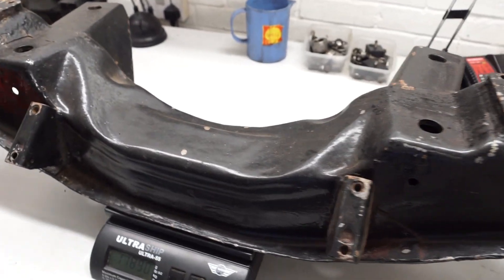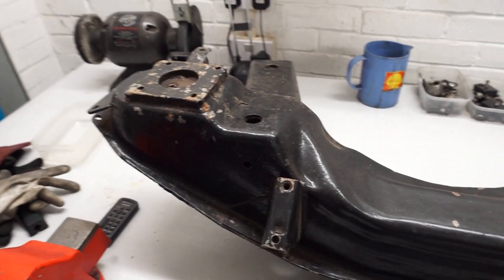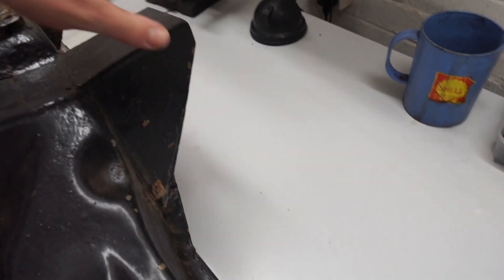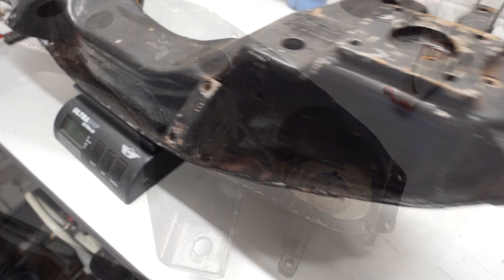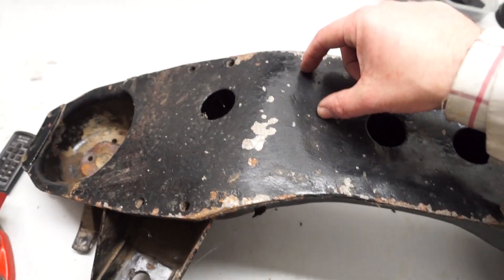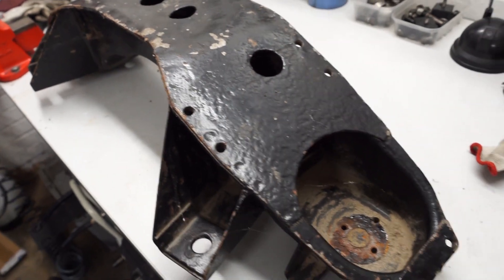Now I've got to plan out what to do with this cross member. I'm very tempted to put a few holes along the front here, and maybe a couple more holes here as well. If I aim for around a 500 gram weight reduction, that might be more sensible than doing too many holes as before. I'm going to leave the chassis leg area entirely as-is — that's important to keep the rigidity up. I probably won't put holes in the top either. Underneath I might put a few more lightening holes, but I won't cut out the entire middle section like Alps did. I could probably do with losing a few kilos myself after Christmas, but sometimes it's easier to drill holes in metal instead!